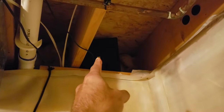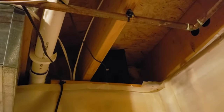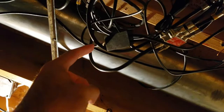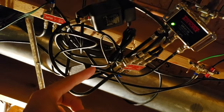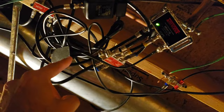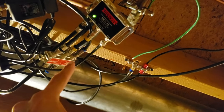According to the RCA antenna app, I need to point the antenna in a specific direction. Even though it's multi-directional, I'll point the front that way. The cord runs across and into the power adapter, and then the other end goes into another booster which feeds into my splitter, distributing the antenna signal all over the house to all the bedrooms.